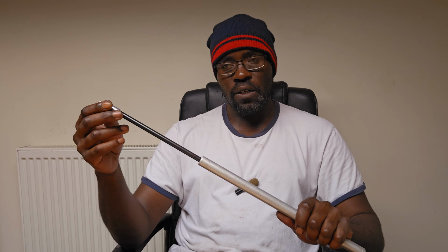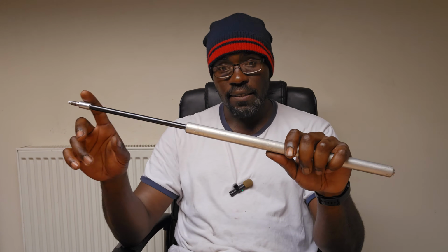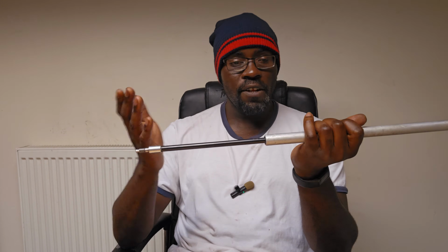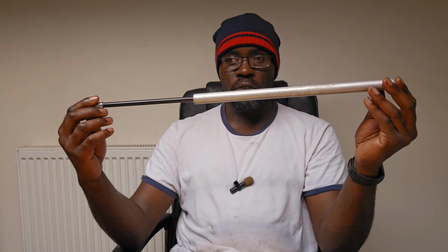Like I said, there's no method that I can see here by which you can adjust the travel. The only way I can physically think of to adjust the travel is you'd need a new one of these. This is 180 millimeters, so this is the part which determines the actual travel. There are no notch systems like Suntour, no volume travel adjusters you can put into this. And even if there were, it wouldn't affect the length, it would just determine how much travel you could use. So ultimately, this is what I'm working with.